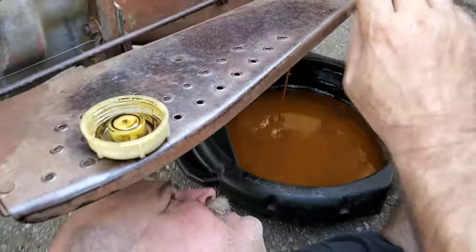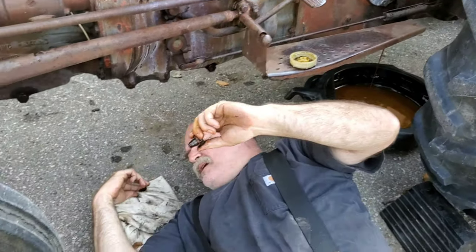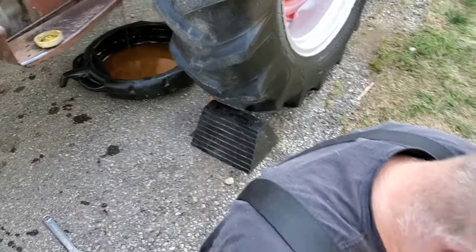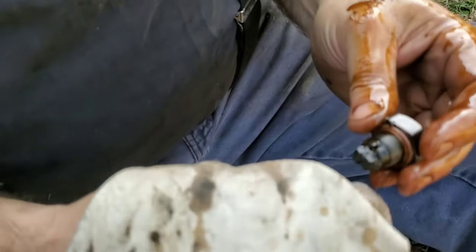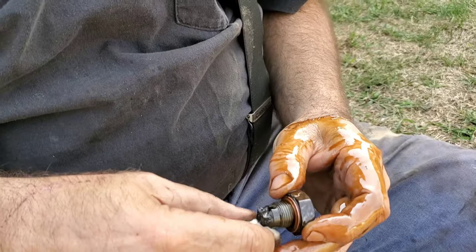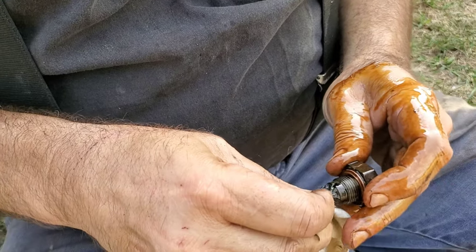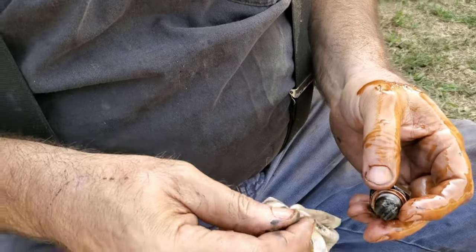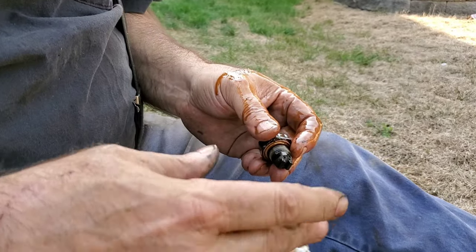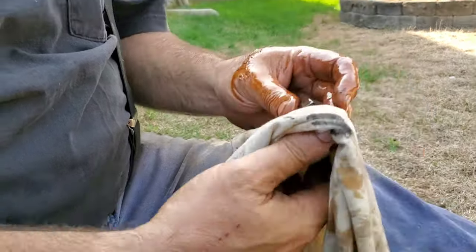Okay, can you move it away? That's going to be okay to drain out now. We'll let that drain out, and then we'll get the other one ready. It doesn't smell like, I mean, it's thick, so it was probably the right oil. And these drain plugs are magnetic, by the way. They're all full of, you know, it's not bad. I don't know how long this has been, but there's no chunks. There's the wear, the rubbings, as they call it. I don't see anything shiny, nothing silver.